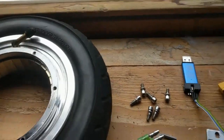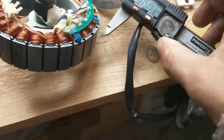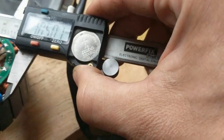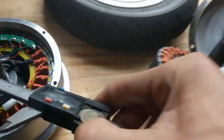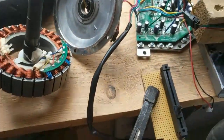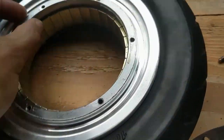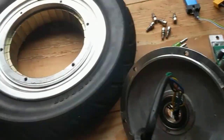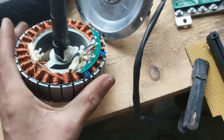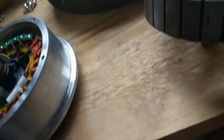Inside you find 30 neodymium magnets on one side and 30 magnets on the other, with 27 coils at about 10 to 10.5 centimeters — that's exactly the same as the 6.5 inch motor, so they are nearly the same. Therefore it doesn't make much sense to use the larger motor because the bigger diameter is only used for the tire rims and inflatable tires. The shaft is a bit longer, which might help.